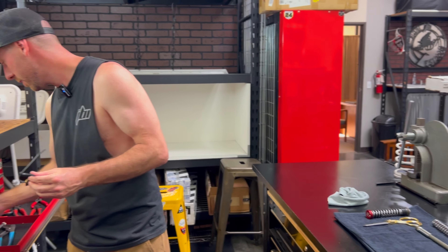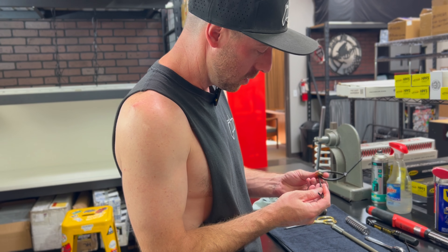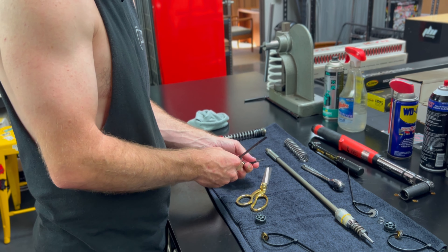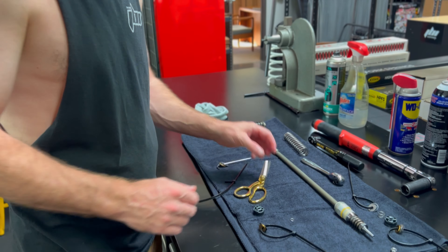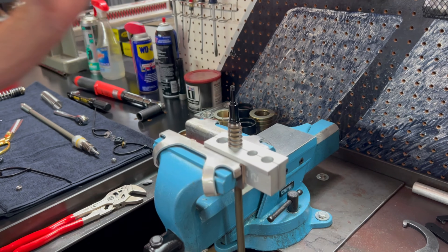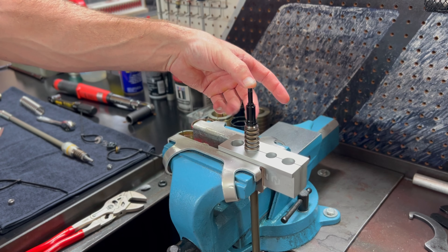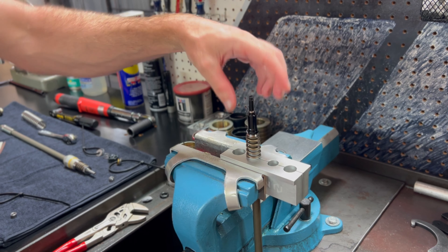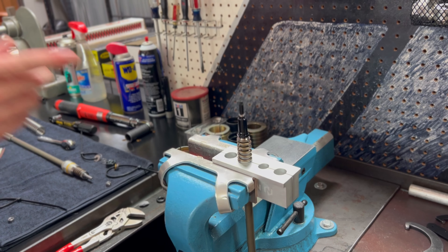I've got a small number four Allen key — let's slide it through the center of the shim stack to keep them organized. The titanium spacer is the first piece that goes onto our mid-valve compression piston post. I've removed everything — the mid-valve piston and the cone valve assembly — so we just have the black OEM WP cone valve mid-valve compression post. Make sure there are no shims on there. The spacer installs first and extends the length of the eight millimeter post where the shims ride and float up and down.